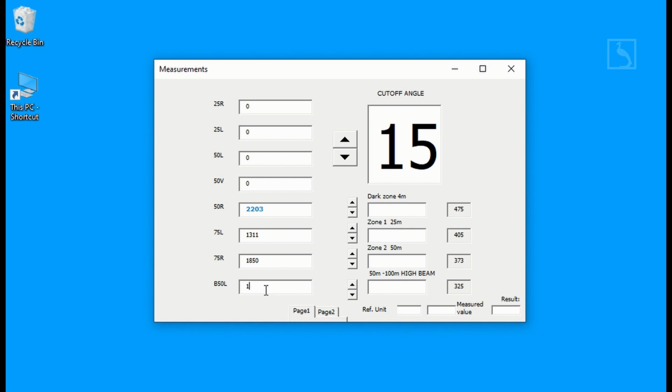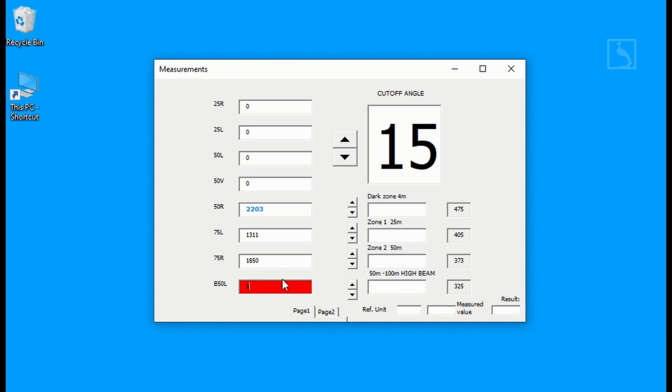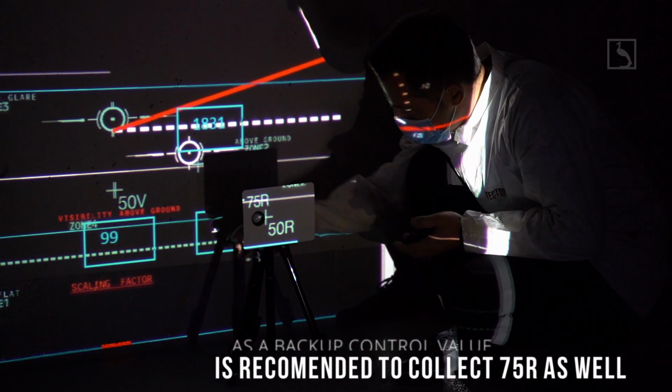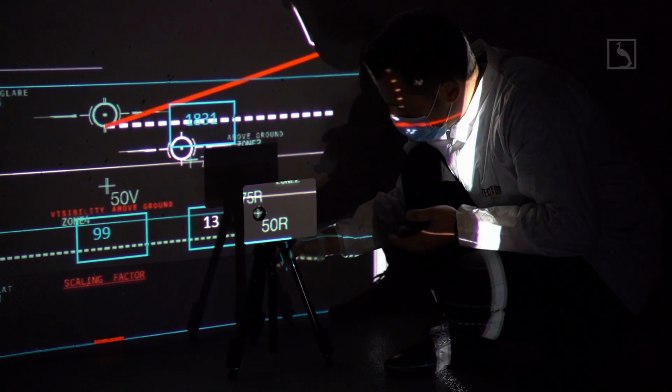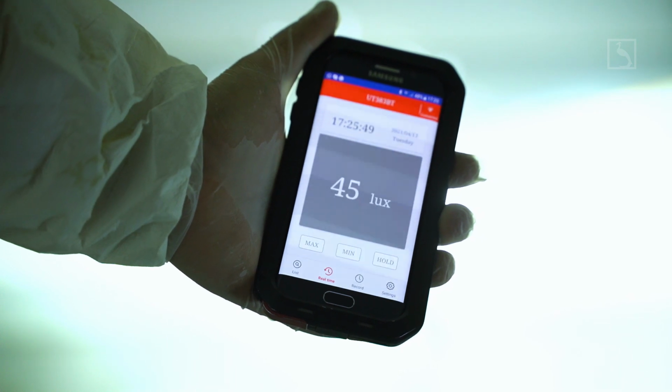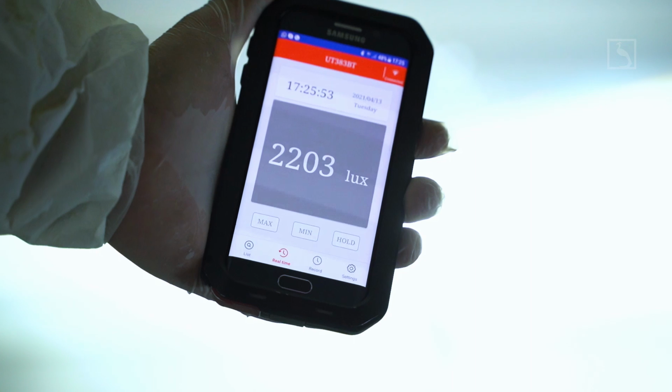For your high beam, be aware you only need to check the hot spots position, which has a different symbol marker than luminosity control points. For the short range test, only the 50R luminance value will be helpful in order to check for symmetry between left and right headlight. In the next video, part 2, we will reveal the final results for the 25 meters test.